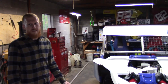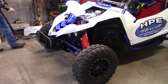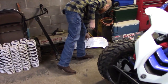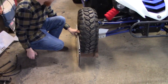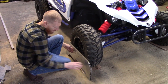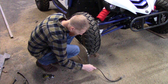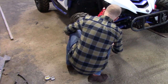The same works for asphalt too. So now we're at zero. Get the toe boards out — you'll need two tape measures. What I do is get it set where I want it: when you put your toe board on, you don't want it favoring more front or back, just as square as possible. Then it gets kind of tricky — you take a bungee cord and wrap it around to keep pressure on it so the toe board stays tight to the wheel, like you've got your foot on it. Hence the need for two people.